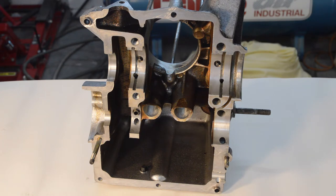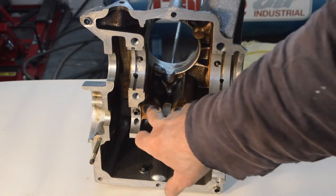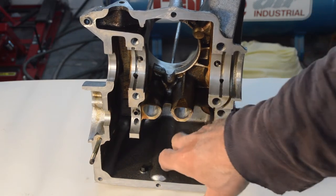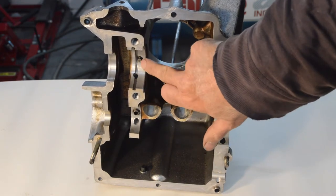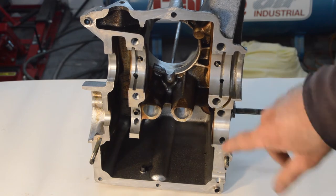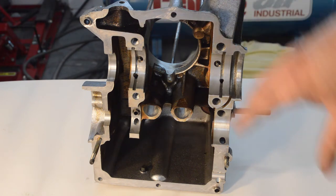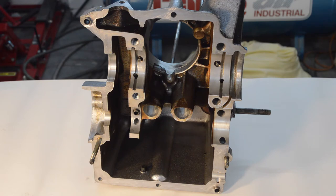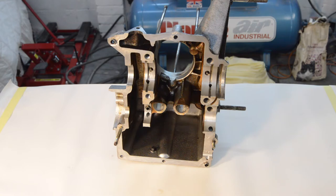The crankcase housing is back out of the washer, having had all the gasket area cleaned off. The bores for the tappets have been checked for scoring, marking, and gouging - they're all perfect. Where the main bearings sit, they are all in excellent condition, very minor marking as you'd expect from a used engine. All the surface points the barrel is going to fit have all been cleaned, the dowels are in place, and basically I think we're ready to start rebuilding the engine. From now on everything is going to have to be done with extreme cleanliness.